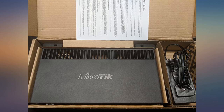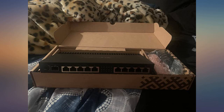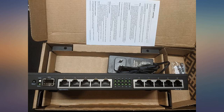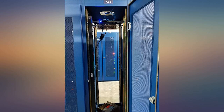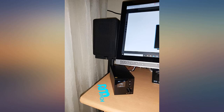I have used DD-WRT-based routers in the past as a way to have a feature-rich device at a lower price range, but the experience was not that good. Finding the right firmware-device balance was not easy. I'm not a big fan of integrated Wi-Fi on the device — Wi-Fi radios should be on a different device to be replaced at a different time. At some point I moved to a Cisco RV325 that started well on a clean setup but performance started to degrade after enabling some basic features.